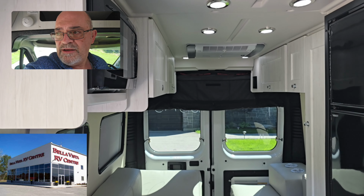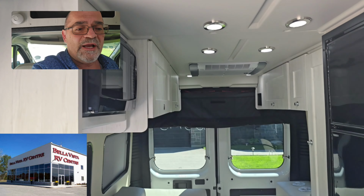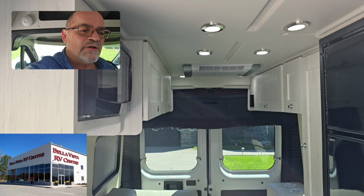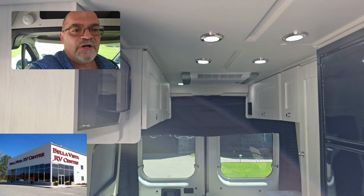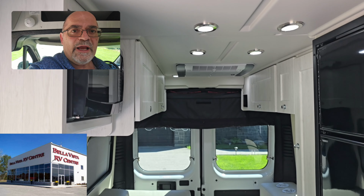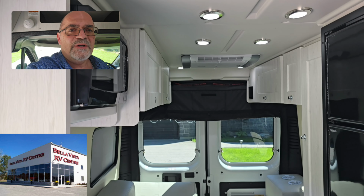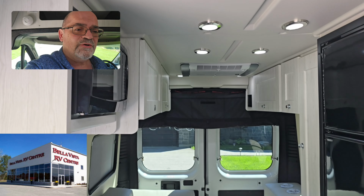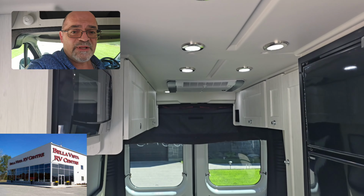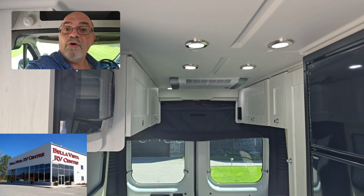If it's like today with the sun out there, a little bit longer because you'll be getting a little bit of topping up. Now the solar panel will provide some power. It's 300 watts. So it's more about maintenance of the battery. It's not generating enough power to fully power, but it's going to help maintain the batteries, especially if you're running like lights. You start putting a bigger draw like the air conditioner, for all intents and purposes, and I believe the information that I've gotten from a couple of sources, that it looks like you could run this Chase all night long.